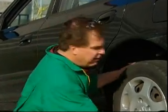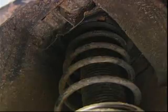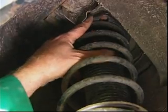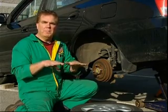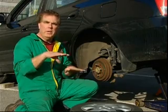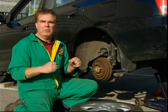They're great. Now, this week I want to talk about a very common suspension noise that you can get in the rear suspension of many cars that have McPherson struts on all 4 corners. And that's when the upper mount on your McPherson strut wears out, and it can be a difficult thing to diagnose. The noise can be really bothersome. You tend to get the noise on rough pavement, especially if you're going over rough pavement, say turning into a driveway or anything where one wheel hits ahead of the other, and you'll hear a banging or clunking or thumping sound in the rear suspension.